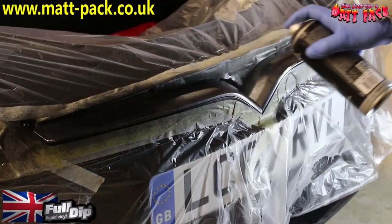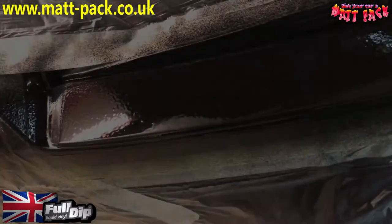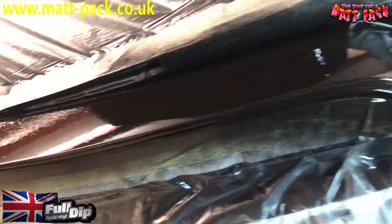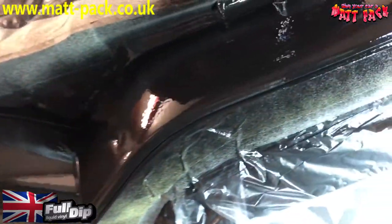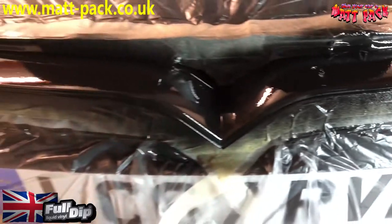If you look at the masking around it you can see there's hardly any overspray. Let that dry, and as soon as it turns matte, hit it with another light coat. You can see it still looks terrible — although it looks all black, it's not fully black. Look at the masking tape either side — you can see it's not fully covered.